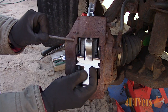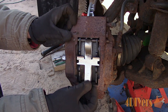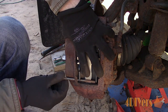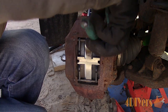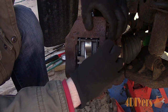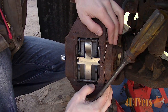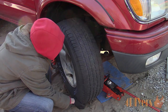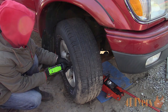Install the top retaining pin with the anti-rattle clip in place — the hook portion faces towards the top. Push down the anti-rattle clip then install the lower pin. These pins should have a sliding fit and may need to be rotated into position in order for the wire retainer to line up. Then install the wire retainer and push the hook portion into the caliper hole. Make sure the hub surface on the wheel is clean — use a brass wire brush if needed — then install the wheel back onto the truck. The torque specification for the wheel is 85 foot-pounds or 115 Newton-meters; however, this may vary between years of trucks.